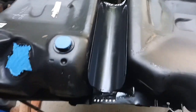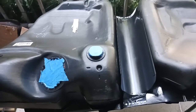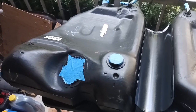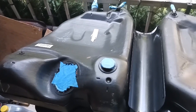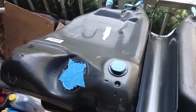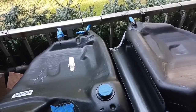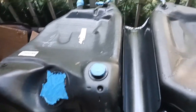But I didn't realize I never took the time to explain why I'm doing this to the gas tank. It was part of that problem I said before, where you'd be driving like normal, and once it's warmed up, it would randomly just bog down and want to stall out. I still think it's an electrical problem, though, because it was like that, like I said before, the old IT method, you try turning it off and back on again, because turning the key off and back on is the only thing that'll get it running again once it starts doing that. But I wanted to eliminate the gas tank as a possibility, and I was probably right in assuming that it's been sealed up since the factory, so I just wanted to get it out and get an assessment of it, and the fuel lines, the fuel sending unit, all that stuff.